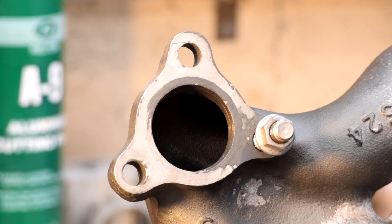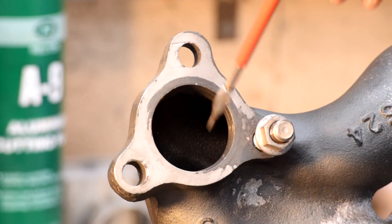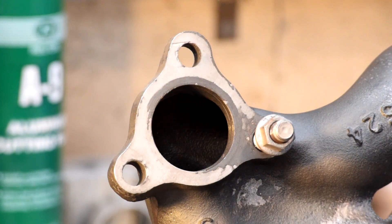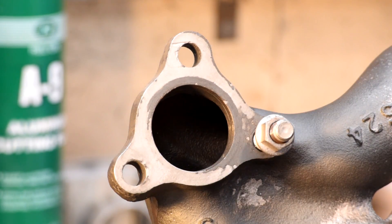On the turbo side of the cast iron manifold we were able to completely eliminate that flame ring — just went in and cut it out, then radiused the back step so it's a nice smooth transition out of the runner. That worked out pretty nicely. Next step after ceramic coating, you can see where it's got some soot on it — just run it through the mill and face it off so it's nice and flat. So that gives you an idea of the kinds of things you can do with attention to detail on exhaust manifolds and how to prep them to get a little more out of them than they came from the factory — especially that steel one where the ports were choked off so badly with the welds. Thanks for watching.